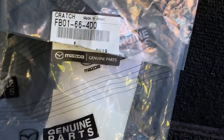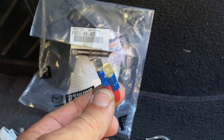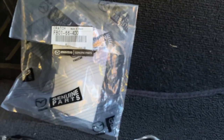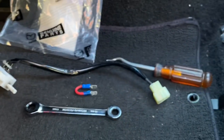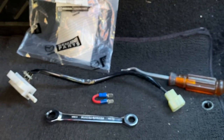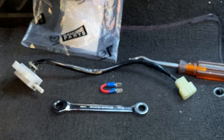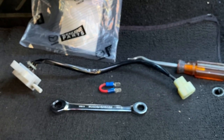So two different ways to do it: install the brand new one, which we've done here, or for diagnosing purposes put a jumper into the plug and see if it solves the problem. And if you just want to leave it in there and not have your clutch switch involved in starting the car anymore, that's something you can do too.